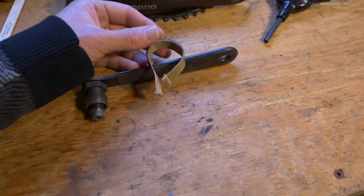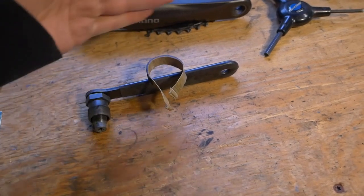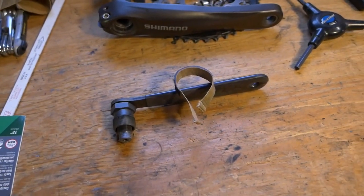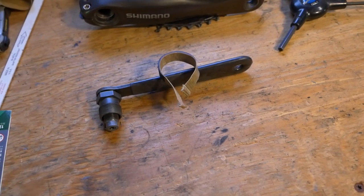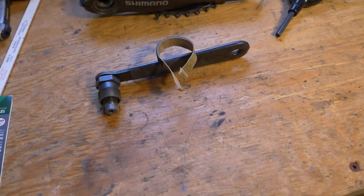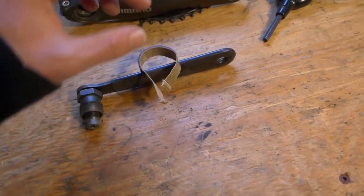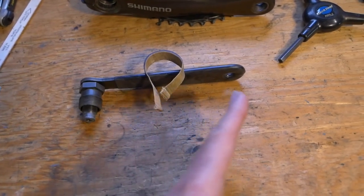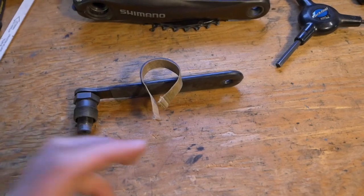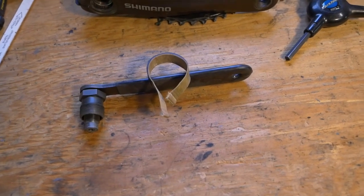It's a close approximation — not exact — but it's good enough to do basic analysis when doing relative comparisons. If we're comparing this tire and rim to a skinny tire and rim, it's okay to make the same assumptions for both systems, because that way you're comparing the relative differences, not the absolute differences. The analysis I did would not have provided absolute values anyway — there are just too many assumptions in the modeling, and that wouldn't result in realistic numbers.